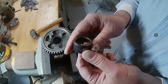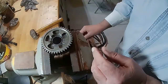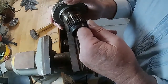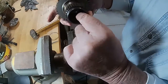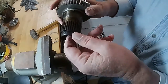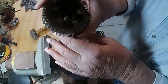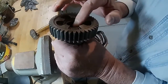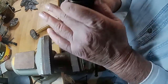And it's out. There is the bearing we just knocked out, and that's what it looks like inside. Now you take your finger in there and roll your finger around — make sure there's no metal, nothing like that. Now we're going to clean this out, but first we're going to remove this one. And this one we're going to remove on the press. You can remove both of them by knocking them out, but I'm going to take it over to the press and show you how to do it on the press.